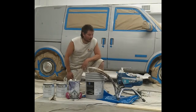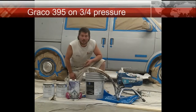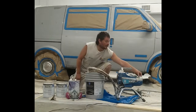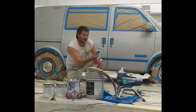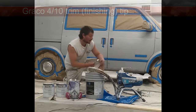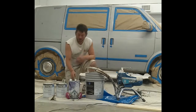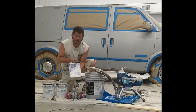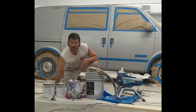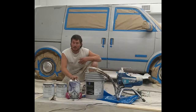We are ready for our little product rundown. I'm going to be using an airless sprayer. I was going to use an HVLP, which I have, but I wanted to try using a fine tip. This is a 410 tip — that's a wide pattern but it's a finishing tip, so it's going to be really, really thin spray. I'm going to run a fair bit of pressure on here. We have some Xylene here — Xylene is what we're going to use to thin the paint down a little bit, give it a little more open time and make it a bit easier to work with so it doesn't dry too fast.